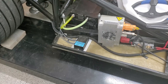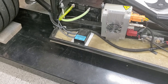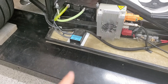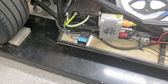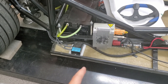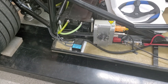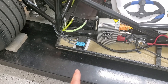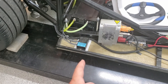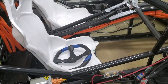Remember how I said 99% of the problems are my fault? I just saw a comment from Pantera Electronics — the guys that make this electronic parking brake controller — and they said based on the green light being there, they thought I had my 12-volt constant and 12-volt switched wires swapped. I confirmed that they were indeed swapped, so I switched those to see if the parking brake gives me better results.